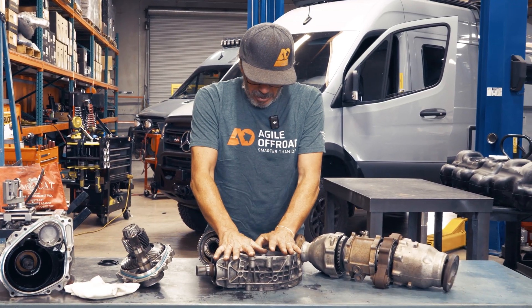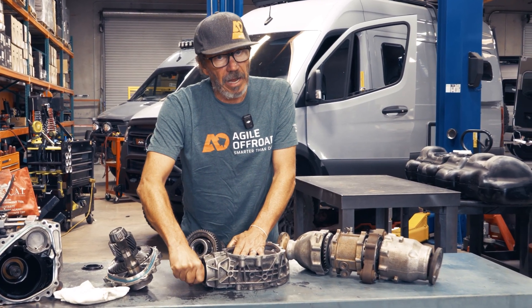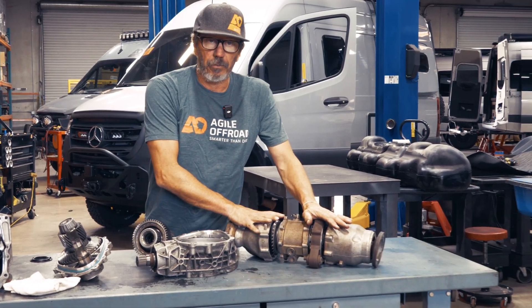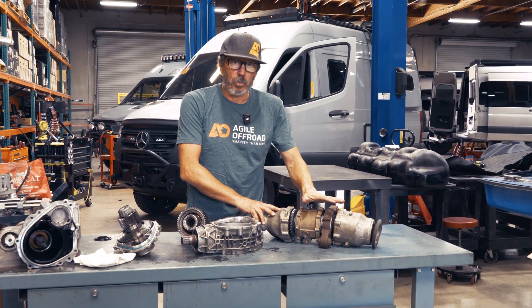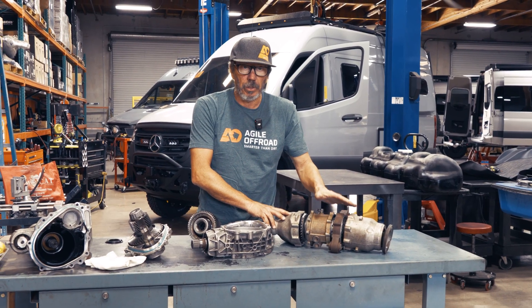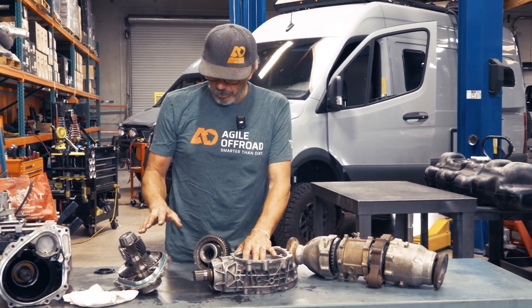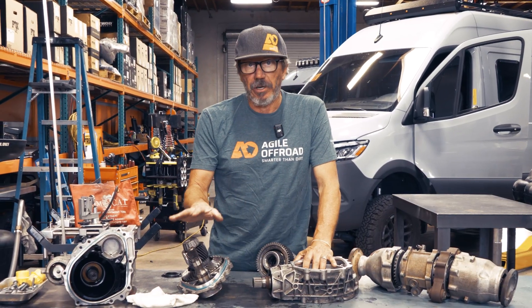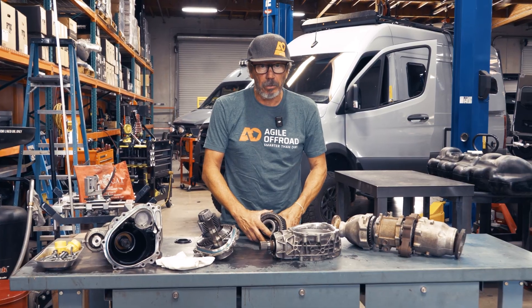In the case of the all-wheel drive, this gear ratio we're assuming has to match 100%. Whereas in the front differential for the four-wheel drive, because it had an open center diff, all gears were the same ratio, which calculated out to about 4.20. So with your all-wheel drive, if you're thinking about changing your rear gears, you can't — you'd have to get a matching front differential. So that's it. It's a pretty cool little piece.